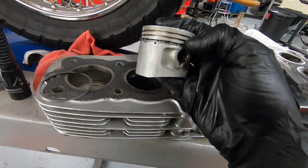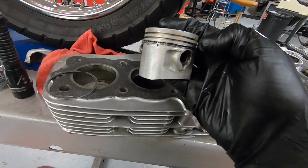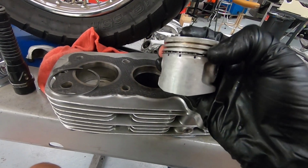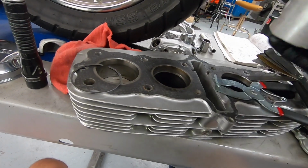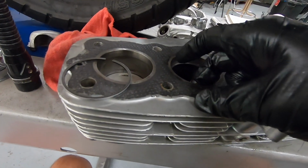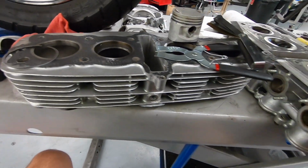That said, I've seen some devastating things happen with too tight of an end gap, where if you have enough cylinder pressure, it will push the ring totally together and you can actually snap off these little ring lands on the pistons. Luckily that didn't happen either, but the saga continues. It's very strange that that's not a problem either.